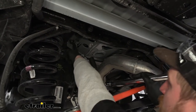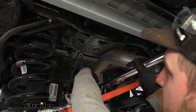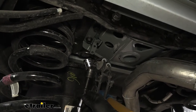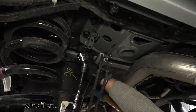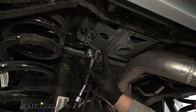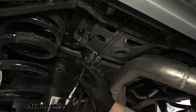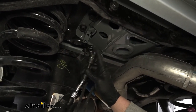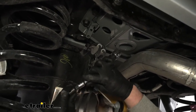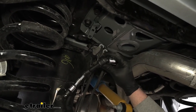When you torque, you want to make sure to torque down the four bolts on the bottom first, and then come back and get the bolts on the side. For the bolt that's all the way back here, it's a little tricky to get to. What I found works best is to use a combination of tools: a socket, a swivel, an extension, and a flexible extension — all in three-eighths size since it's a little thinner — and then an adapter that goes from three-eighths to half-inch so you can get your torque wrench on it.